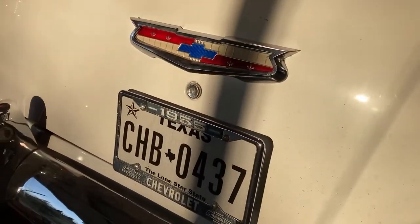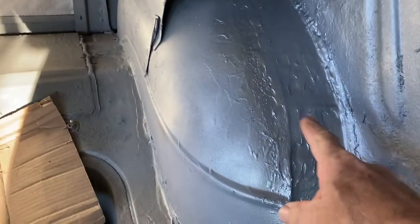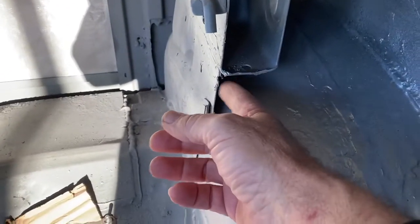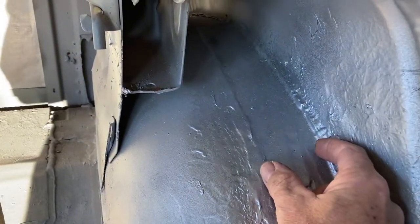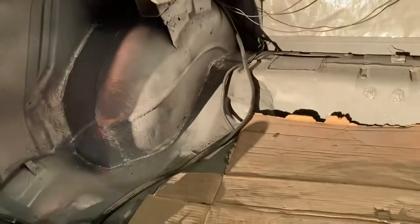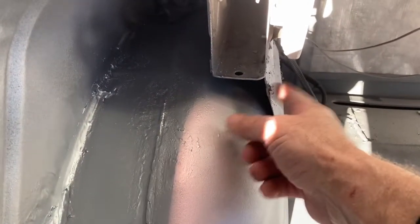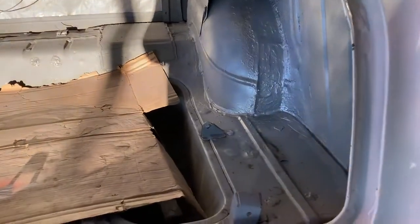Remember I was talking about these tubs. So when you open the trunk, what you're going to see is these tubs — you can see this section. I'm going to let the body shop guy fill that in if he wants. They're all moved over now. If you remember, this bracket was over here, and the width of this brace right here is about what we cut out. So this bracket was welded to this side, it's now moved over and welded, kind of filled in — same way on this side. You can see this piece of steel; it's welded underneath, welded on top, filled in all around here, all the way to the inside of the car. This is the brace that was over here, now it's all welded to the outside. What that does is give you the stock-appearing look without a hot rod race car-looking wheel tub — it's all pushed back.